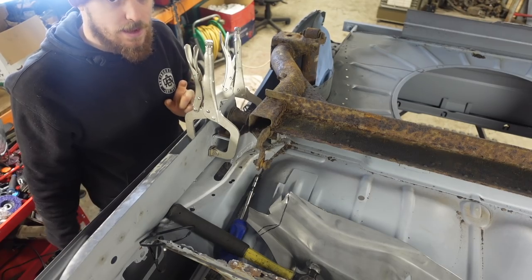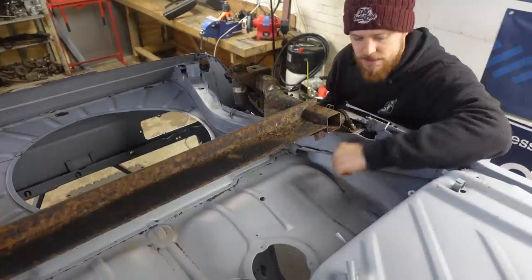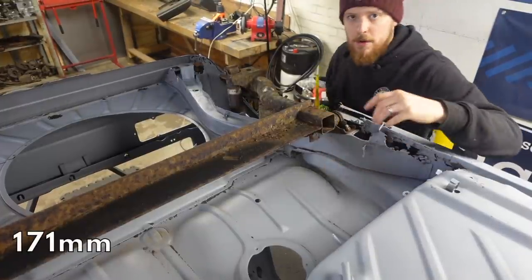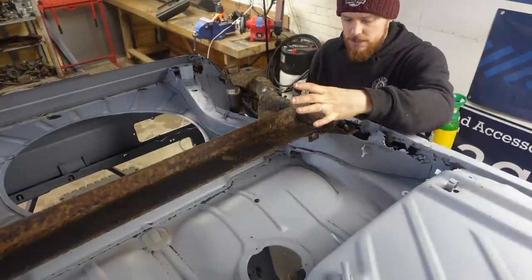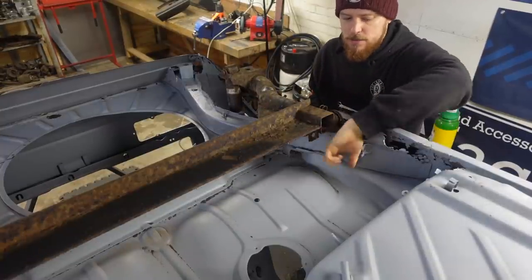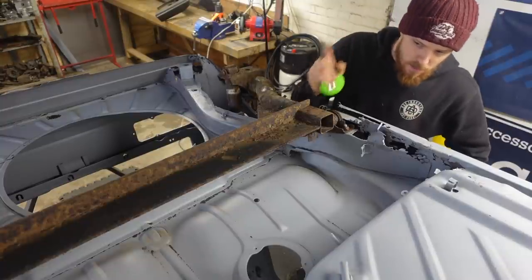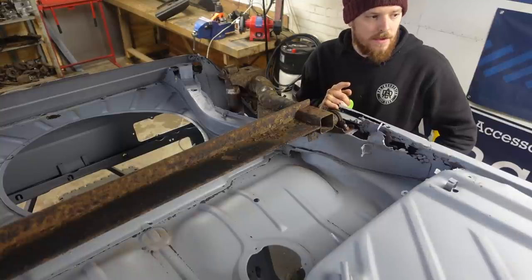For the height check, there's this piece here where the chassis rail goes — it's nice and flat. I'm putting the tape measure down onto that point and it measures 72 millimetres. So from there to there is 72mm on that side. On the other side it measures 71mm, which is right because we've still got one mil of chassis rail material on here — so that accounts for the 1mm difference.